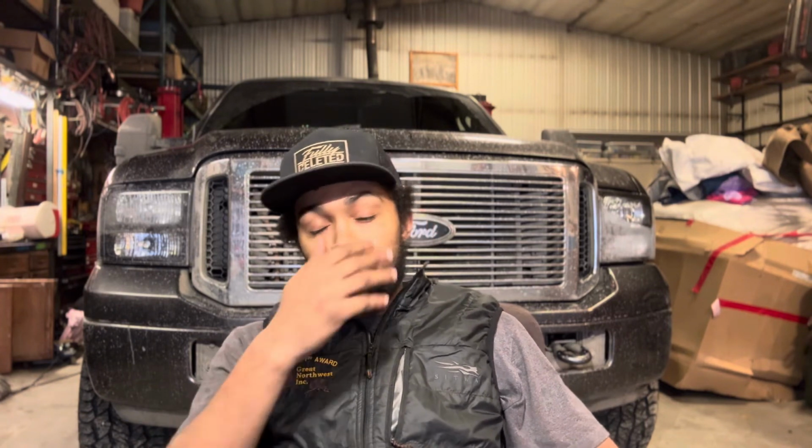It's gonna get there, hopefully. But it's a real nice truck that's getting transformed. Minor hiccups here and there, but at the end of the day, the 6.0 starts up, runs good, shifts fine. I know I do got a hub to replace, the driver's side hub. Has a decent amount of play in it, and I'm not too fancy about it. And I got this humming sound that's coming from it. And figure we'll get a new one coming in, make a video on that.